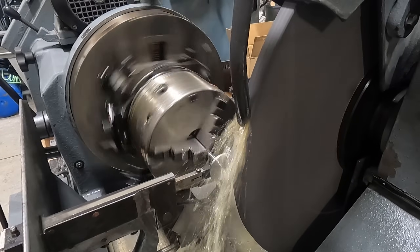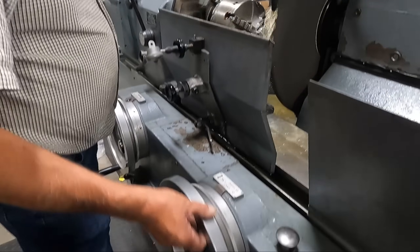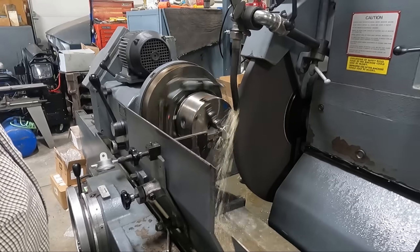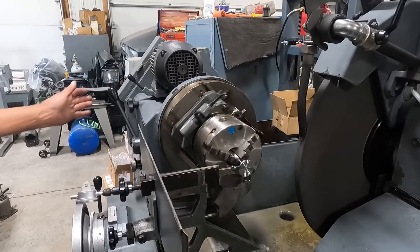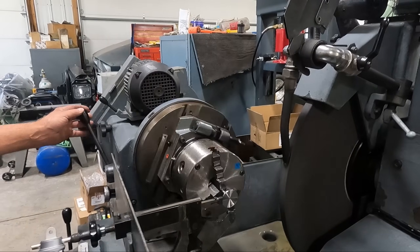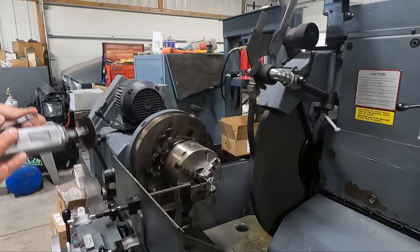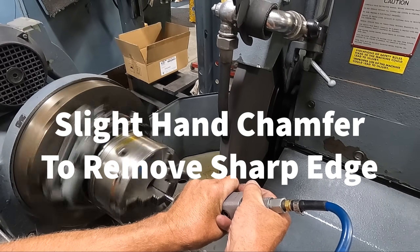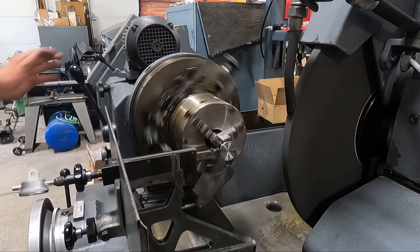And spark out. Back the wheel away from the valve, back the wheel completely off, and it should be finished. I'm going to put just a little lubrication on the steady rest so I can keep it moving. I'm going to do a little bit of hand work here with the cutoff wheel — just put a nice chamfer on the edge of that valve. Looks brand new.